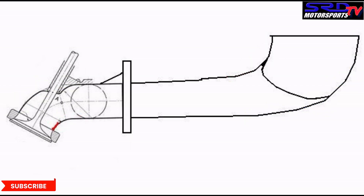On this race mod, we cut off the divider, so the short turn on the intake manifold is significantly less. But when you think about it, the long turn on the intake ports itself still exists, so there's still a difference in speed between short turn and long turn. That's why we still widen the runner entry on the intake manifold. Here's how it looks without the plenum, just to give you a better visual.